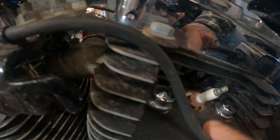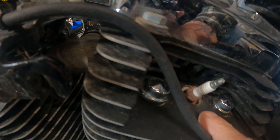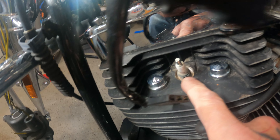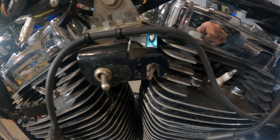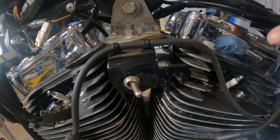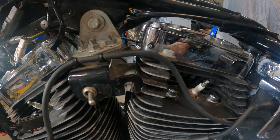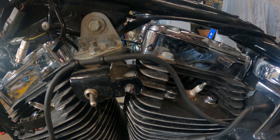The bike ran fine. Maybe they felt they didn't need to, but I think if they're taking a bike in, they really should at least change the plugs. That plug is all rusty. This one is not so rusty. So we're going to take the plugs out and rotate the motor. I've already got this cover off. In order to take tension off the valve train up there, I need to take the compression off the springs.